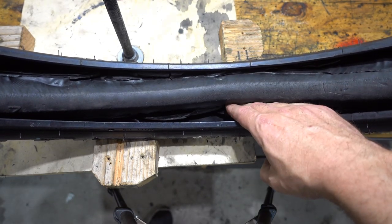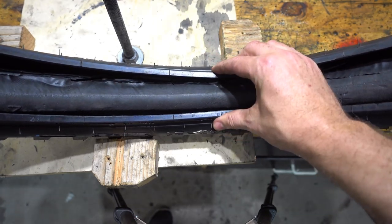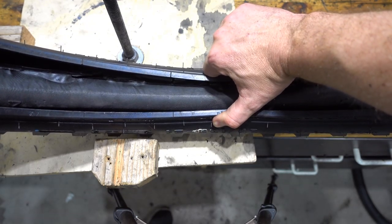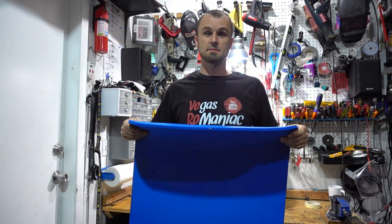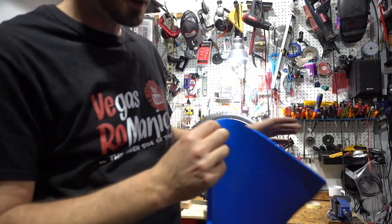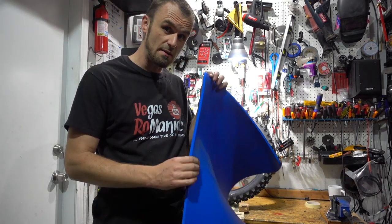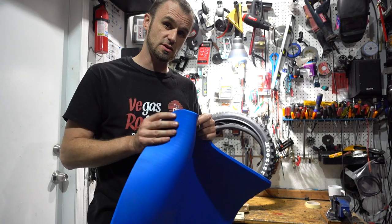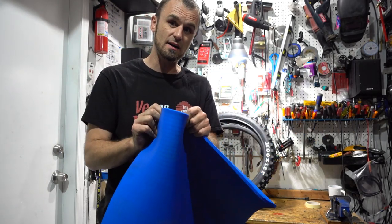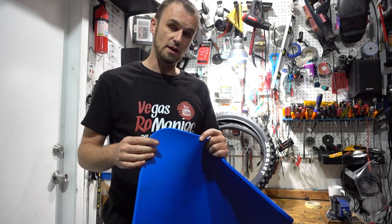You can see how much room there is between the mousse — which also shrunk — and the actual tire. This is an older mousse, but look at the gap. If you put this mousse in there, cranking it a little bit isn't going to be enough. Here's the mat — it has a very close consistency to mousse, so this might be the best filler material for a front tire.